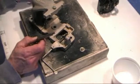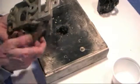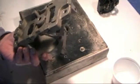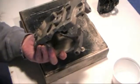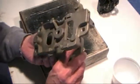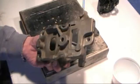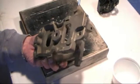Next I'll put the spindle in place. You want to make sure that the ball bearing is down in the hole. I put it in there earlier and stuck a little bit of grease on it. I'll put just a little bit more in place. That grease not only lubricates but it also holds the ball bearing into place.